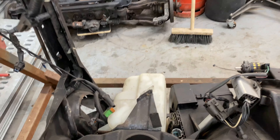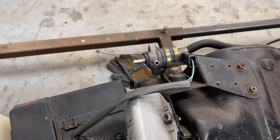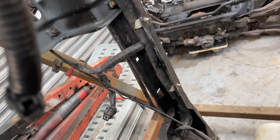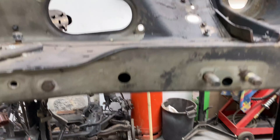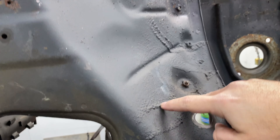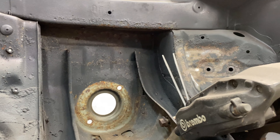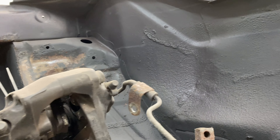There are plenty of holes. We've got one right here — Nick is going to be able to recreate this entire panel to cover the hole and reinstate the lip, which runs from about here to here from the OEM spec, as well as bending all this back into place. This gets smashed up when people jack up their cars in the wrong location. We're going to rebuild this whole seam so it looks like it should from the factory and give a proper jacking point.